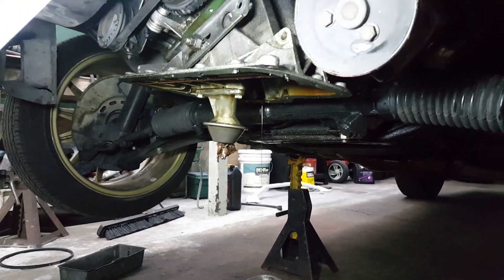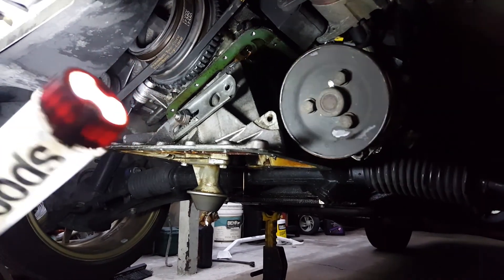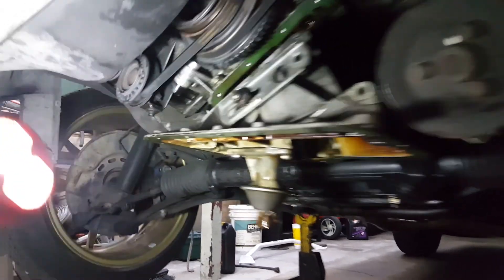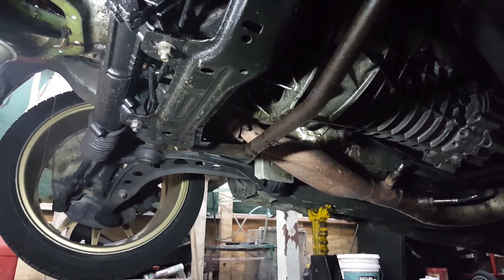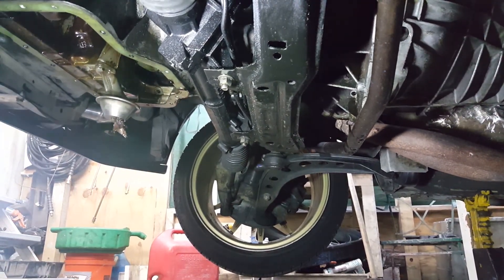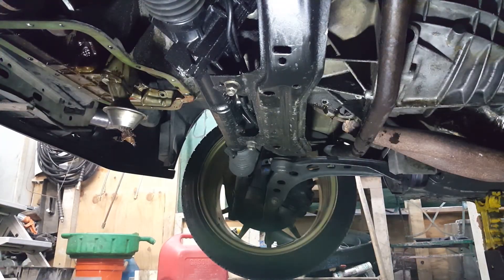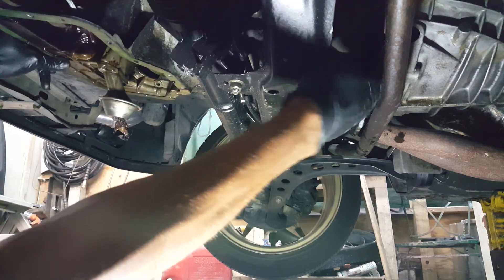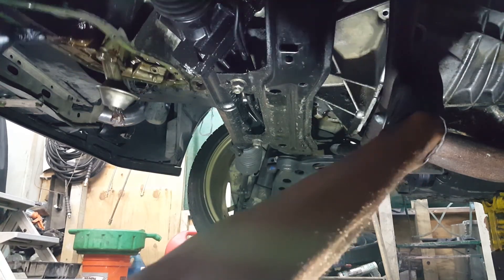I'm back. I got the other bolts — I had to use a wrench for a few of them. And this is the reason why you never use that black RTV silicone. I was wondering whether or not I'd have to pull those back two bolts up near the transmission, and yes I did. As soon as I pulled them the oil pan actually dropped. See, if that gray silicone had been used, this would not happen — that gray silicone actually holds pretty well.